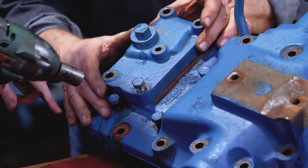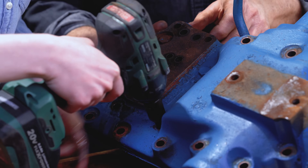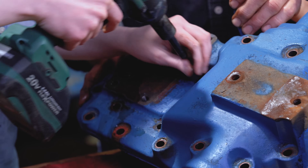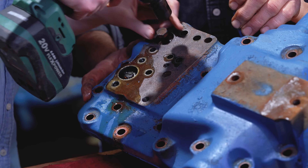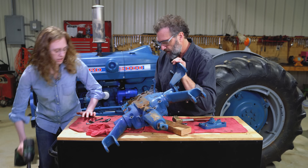You can take the few bolts off your block-off plate — that'll lift off. There are a couple more bolts that hold the cylinder into place, so our next step is to free up that cylinder. There's one bolt underneath the block-off plate that you can't forget about. Once you have all of those removed, you can flip it over.